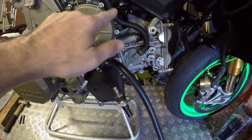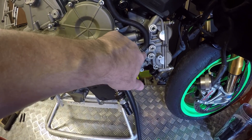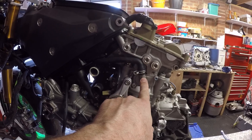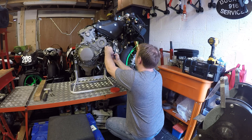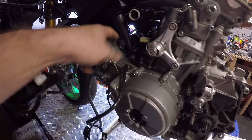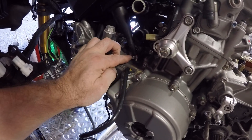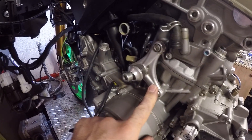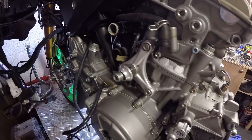What we've got to do next is take off the breather pipes — one for the horizontal cylinder just here, and one for the vertical cylinder. Our next pipe to remove is the crankcase breather, which has got a once-only clamp on it. After that I'm going to remove the suspension mount — one bolt, two bolts, three bolts — and just pull that away as well.